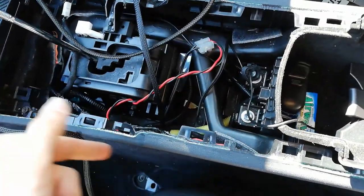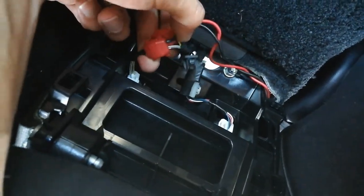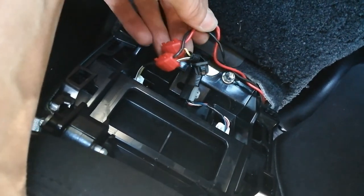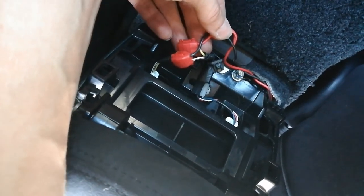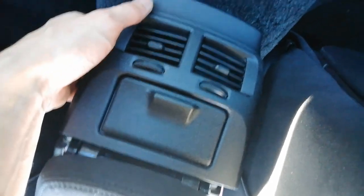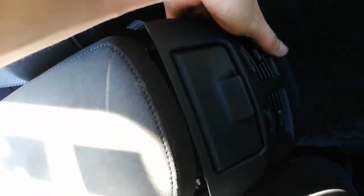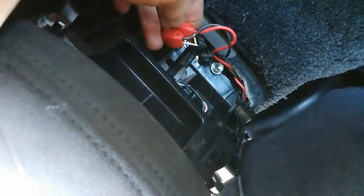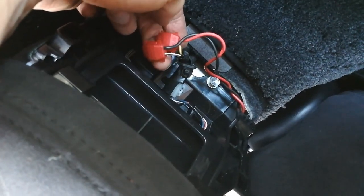To get the power, I'm going to feed it from this red wire here which feeds all the way to the back of the compartment — it's feeding the cigarette lighter. So this is the direct connection to the cigarette lighter. I'm only going to be drawing about 7 amps; I've already measured it and the fuse is 10 amps, so it should be enough power to run the heated seats plus auxiliary items like the radar detector. To get this off, just pull it back and it should pop off. I'm probably going to redo these terminals with something more heavy duty just so they don't heat up.